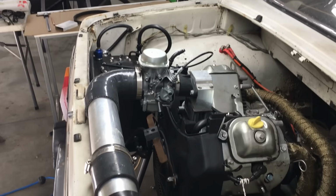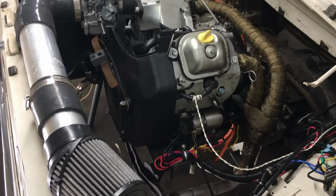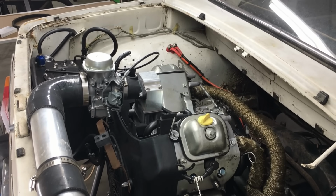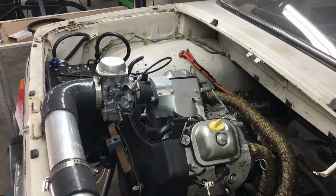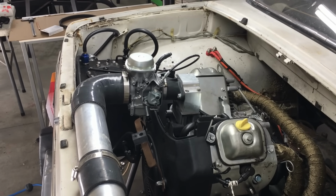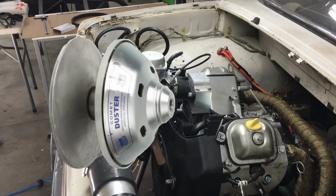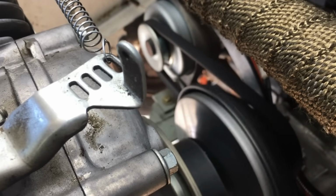Now, if this car was to be permanently powered by this 2-cylinder engine, then we would certainly take it to the next level and upgrade the clutch. And of course, if you were building a Predator-powered car, then definitely don't use the Comet 44 series Magnum clutch on a 670cc engine. Use whatever clutch you want, and it looks like the Comet 94C would be an acceptable off-the-shelf solution. I think for now we're going to correct the distance issue and continue using the 44 Magnum clutch